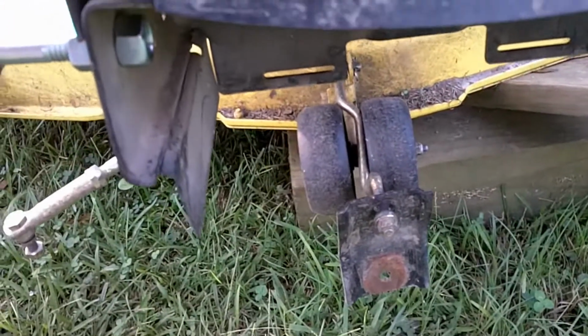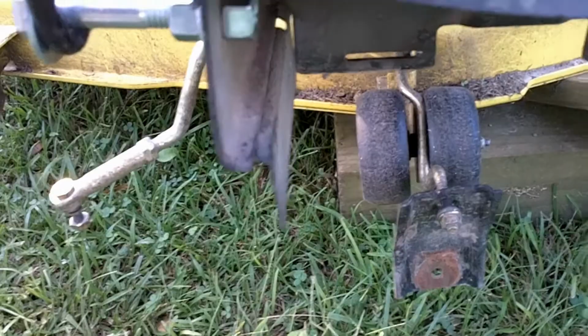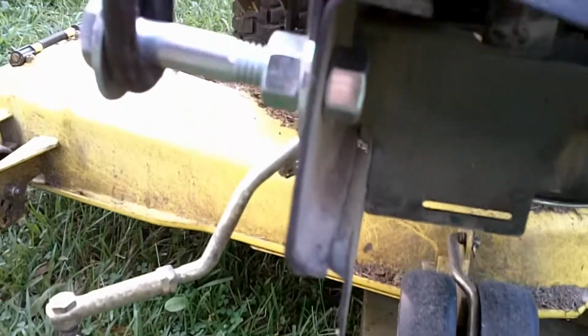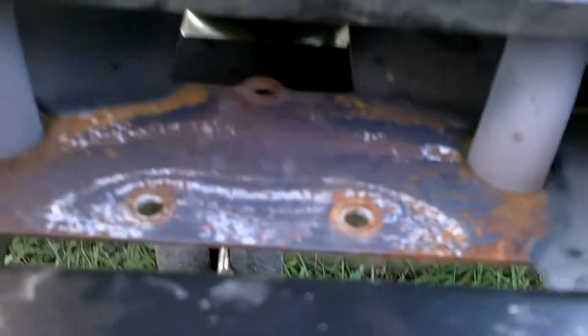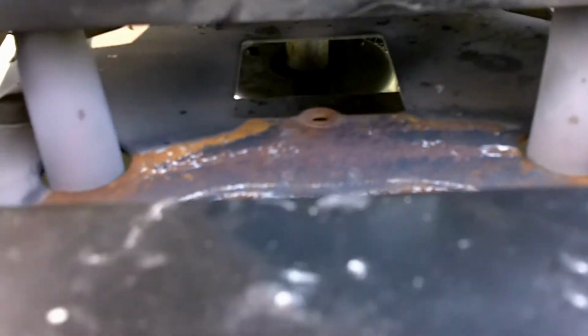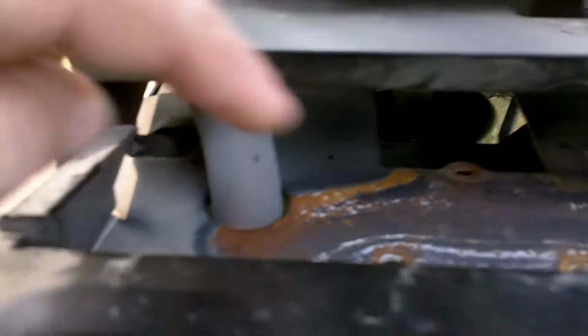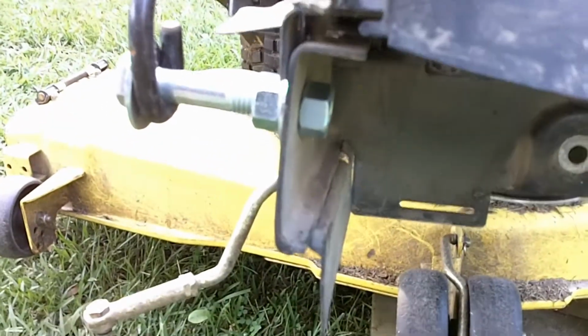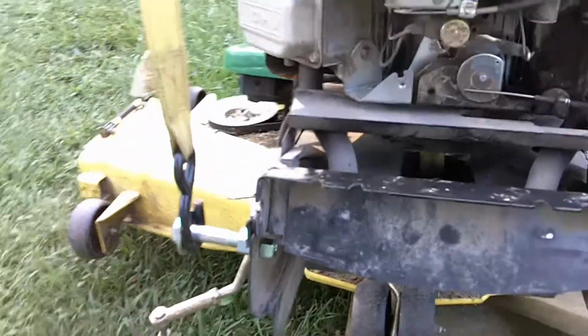I had to take a couple of bolts loose right up in here. That's them sitting right there and there. That takes the muffler guard off. Let's see, had to take 3 bolts right here off, and that takes the collector for the mufflers. I guess what you'd call these little pipes here are headers. They go into a collector, which is actually the muffler, and then it exhausts out the front here. Luckily they're not welded, they just stick down in there.